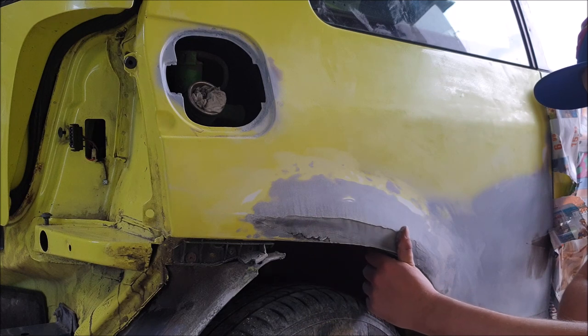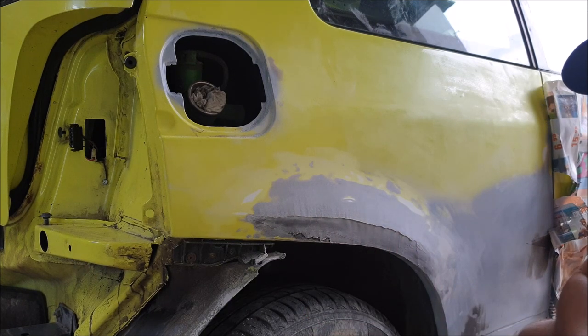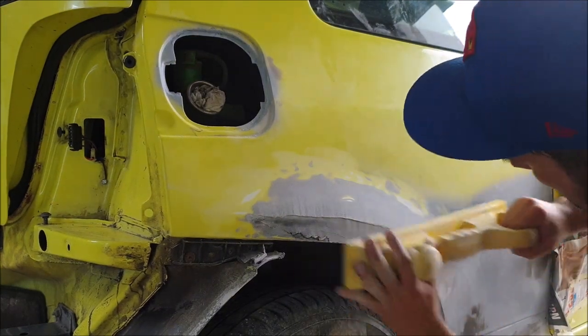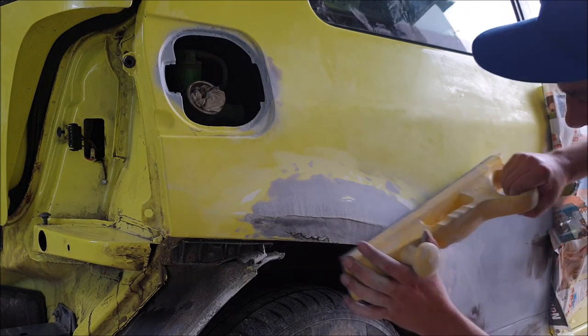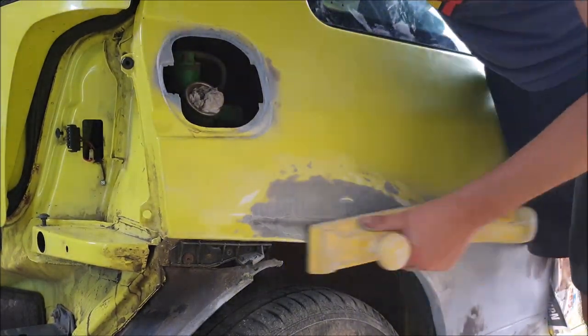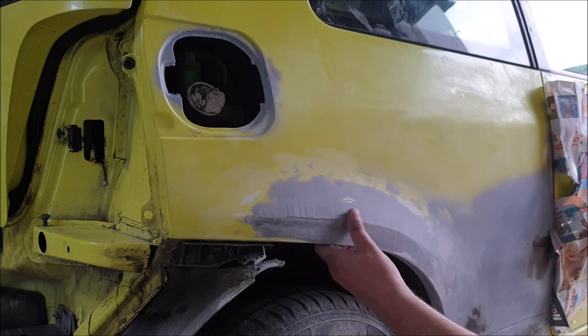Now you need to find the line again, but you need to do this with your hand. Be careful — if you grind too much, the edge is gone. If you want to see the result in between, you can make it wet to see where you are.